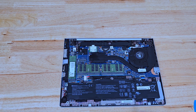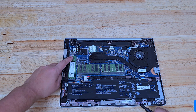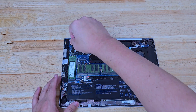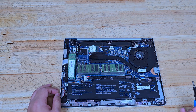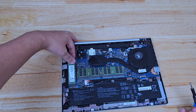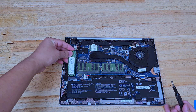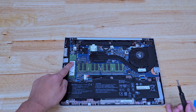And there you have it — that has changed. This is how you change your RAM. The NVMe is held on by this one little Phillips head screw here, and we're going to take that off just for the sake of showing you. It's going to pop up like this and then just slide outward — and it's out. Then when you're ready, put it back in at an angle, slide in, and then push down and put your screw in.